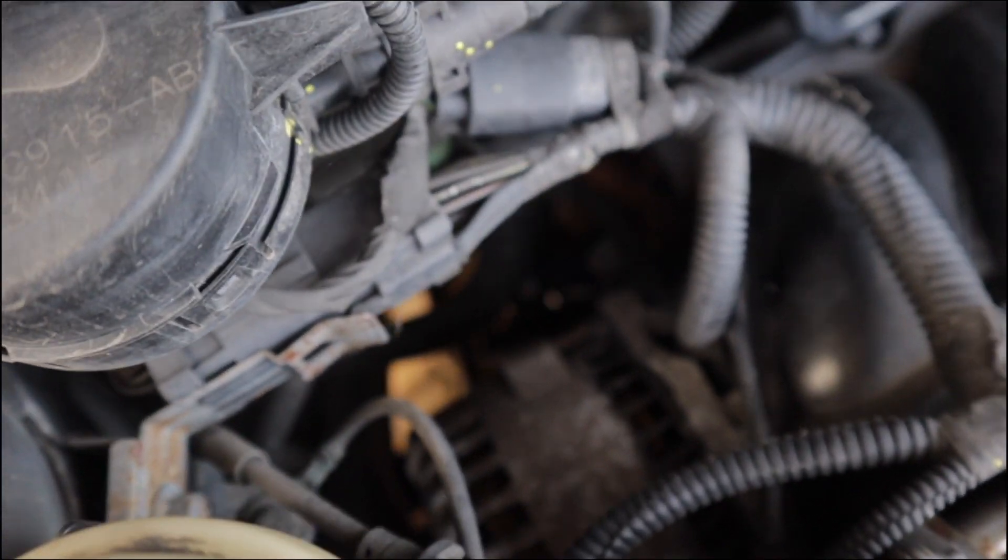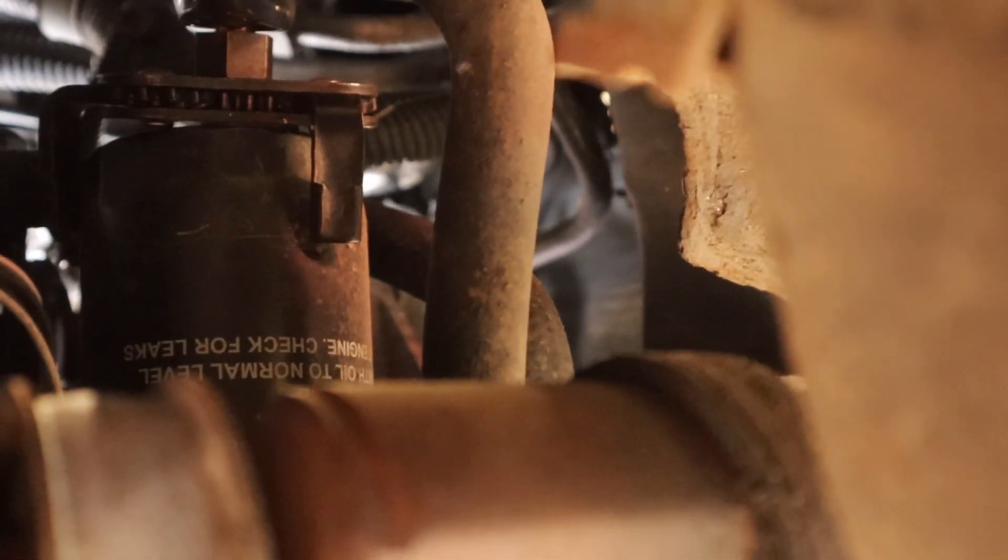The biggest pain of doing a full filter change on your own Ford Focus is that the oil filter is at the back of the engine. My dad is using a crab claw on a ratchet to grab it and spin it. You can do it with your hands but you might not always get the force you need to undo it — sometimes they're done up too tightly. There's the oil filter — right at the back of the engine, an absolute faff to get to, but if you jack the car up or have it on a ramp it is doable.